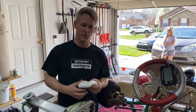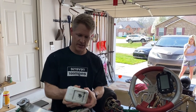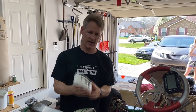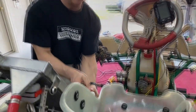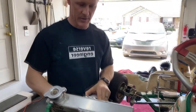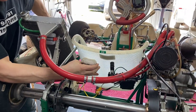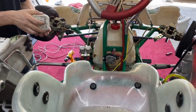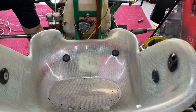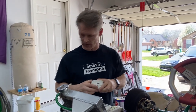When mounting these weights, you want to find a spot where they don't get bound up when tightened. The weights are curved, so you can mount them either way to fit the contour of the seat. A lot of people like to mount them on the back of the seat where there's plenty of space, but I'm putting this one between the legs to keep the front-to-rear weight distribution where we want it — right in the middle of the kart.